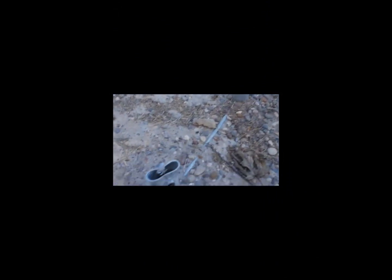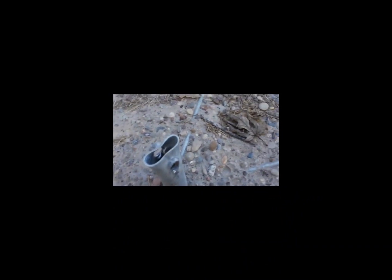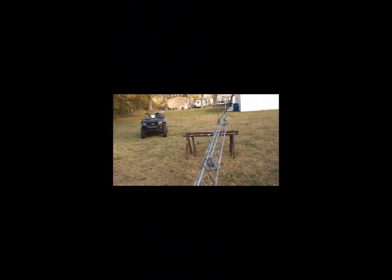There's my break-over apparatus. And there is my major damage that's going to have to be fixed — that was one of those bubble moments, all I can say. This hole doesn't look elongated much — just a tiny hair at most, if any. So this is the one we're going to put solid bar stock in. We'll reform that boogered one out as best we can to get the bar stock in there. But the old Sportsman 700 didn't even grind under it.